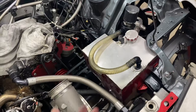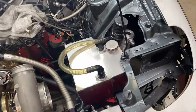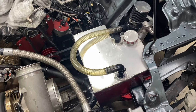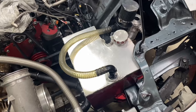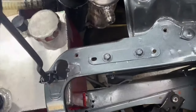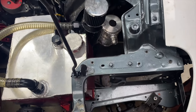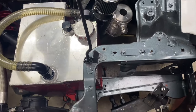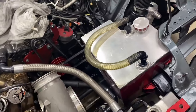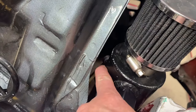This is pretty much the final product. I decided to give the breather lines the shortest route possible so that if fuel does get in, it drains away quickly. I had a single catch can, then I got another chunk of two-and-a-half inch aluminium, cut them down the sides, and joined them together to combine volume — something like two-odd liters. I don't think it's ever going to puke two liters of methanol out of a breather, but better to have the capacity.